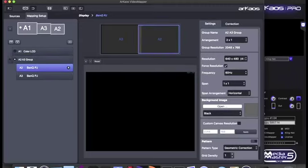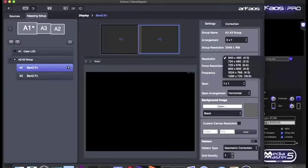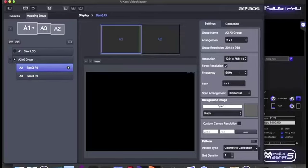Another thing you can do is select the projector that you're dealing with and make sure that you're running the same resolution across both. So here I'm running at 640 by 480, which I really don't want. I want something greater than that. But here as well, I'm running at 640 by 480. So they're both on the same resolution, but we're going to change that to give us something greater. So we're going to go 1024 by 768 on both. And now you see that you make the change on one, and it's going to go ahead and add it to the other.